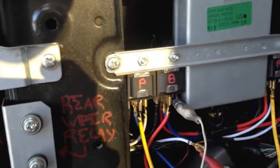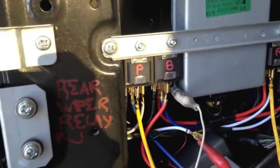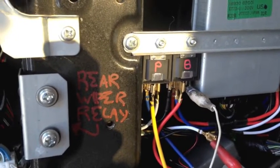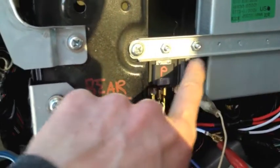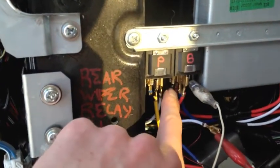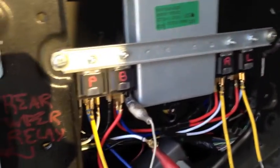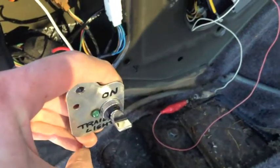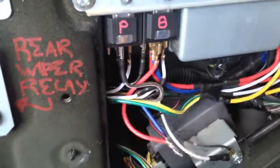Alright, near as I can work out, the problem here is that the brake light circuit in this truck, when it's not on, it's not strictly off either. It just goes to ground instead of positive, which means that ground was being supplied on the signal pin. It was going through the coil and into the bus, which I have hooked to all of these relays. So basically, they were all getting ground. So to combat that, got a diode. That's got her working.